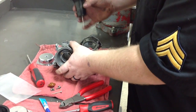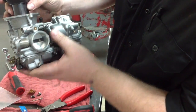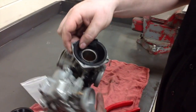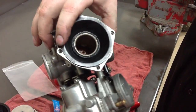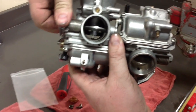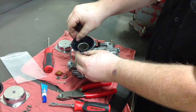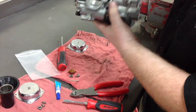This was from the rear cylinder. Take the slide and put it back in, making sure to get the needle back into the needle jet. Slide it around to make sure the dog ear lines up at your mark — you can see the groove down here. Open your butterfly and you can see where that flat surface is, which allows the butterfly to move back and forth. Then let the diaphragm come up a little bit, fold it over — that's the proper way to install it — and let it sit down in here.